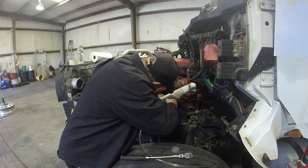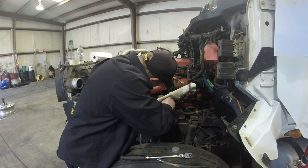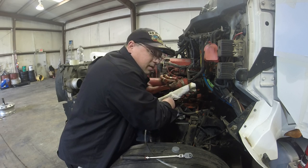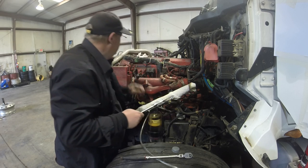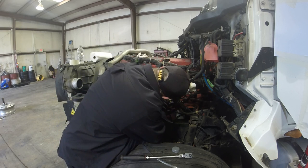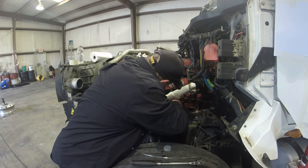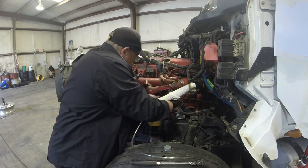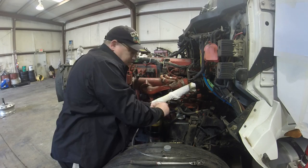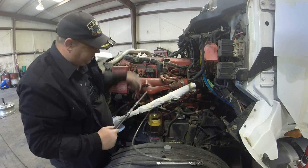Usually, if they come in and they say they got bad fuel mileage, we can test the charge air system for leaks, check the little spots there, and then do an injector leak down, and usually you'll find something. So we're going to use this kit to burn the rest of the fuel out of the injectors and out of the head on the front 3 cylinders, so that when we pull the injector, it don't pour fuel down in the cylinder.